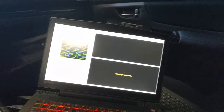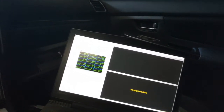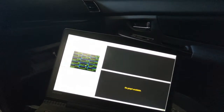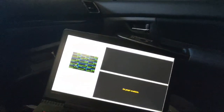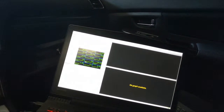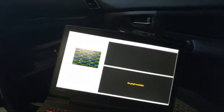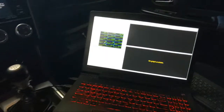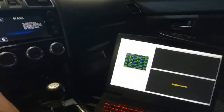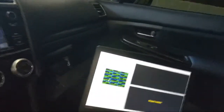And here's our two temperatures. Interestingly enough, temperature is 66 in the manifold and 59 pre-turbo. So that's a little bit of manifold heat soak, most likely, or the intercooler is just too darn hot from being in the engine bay. However, I got a fan on it, so I don't think it's that. It's going to be just a little bit of the heat soak on the manifold. Once I get some airflow over it, we should see a better. Yeah, there you go. Start dropping.